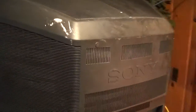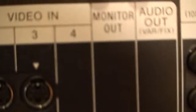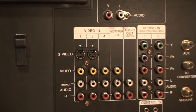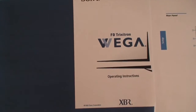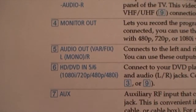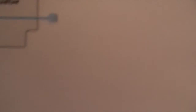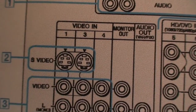Here we have an older tube-style television. As we come to the back, you'll see many connections — all RCA — but only one is going to be labeled audio out. This will be our target. In the case that those weren't labeled, we'd look for an owner's manual. If they don't have one, you can often go to the internet, search by the television's model number, and download one. Here's an example of what we've printed off from the internet — a clear diagram with a description of what each connection does. This is a great resource especially for older televisions where labels may have rubbed off over time.